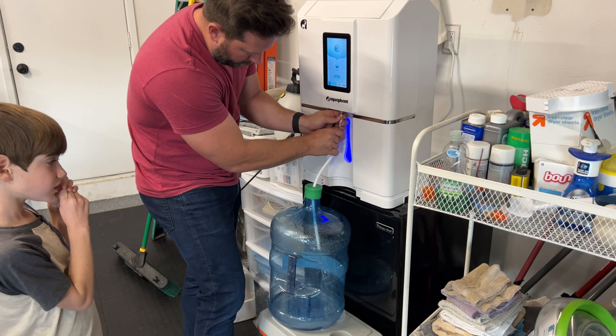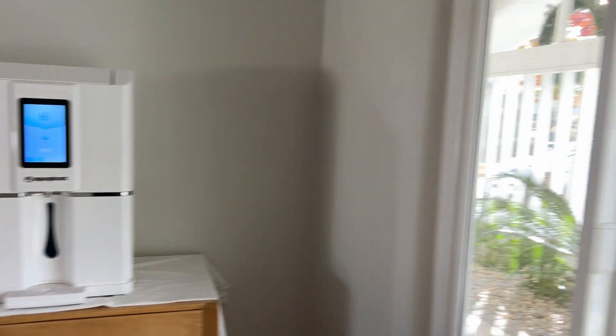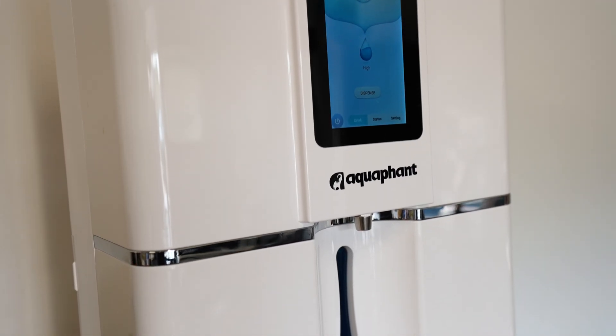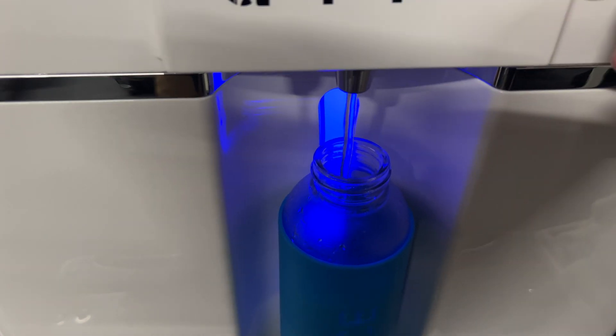That's kind of a bad startup experience — not what you want your customer to get. My kids were literally dying to try this water because they remembered the water from the old house. But once we brought it inside the house instead of the garage, it really started to work a lot better. The temperature is almost always above 60 degrees, but the humidity isn't always above 25%. In fact, because it is a dehumidifier, as it's running it's kind of defeating itself — at some point it reduces the humidity in the room below its own operating standard, meaning it can't run. So we're running out of water even with better conditions; it still can't keep up with a family of four.